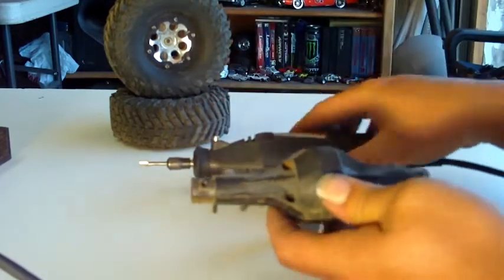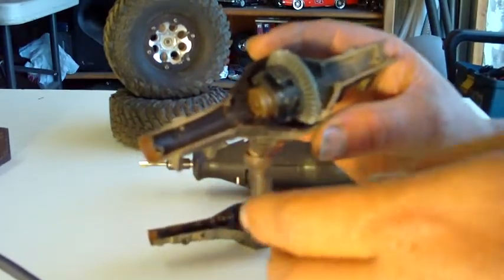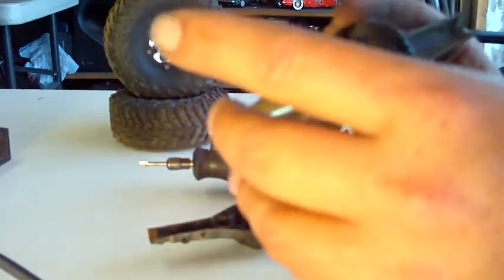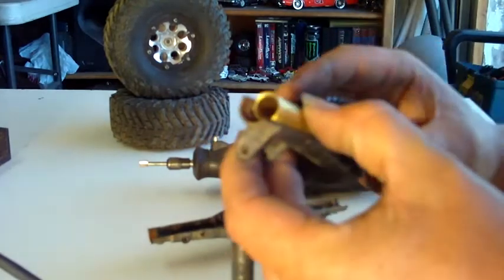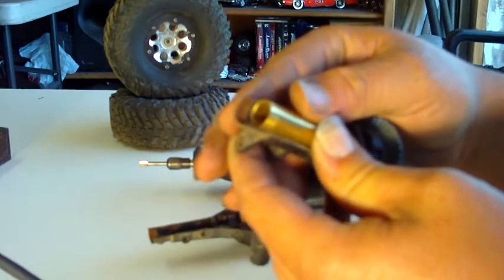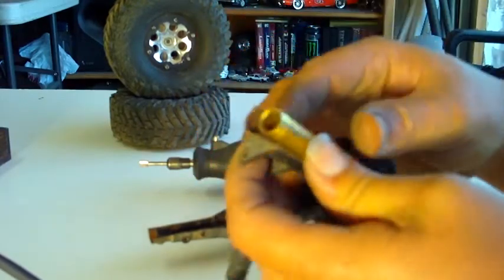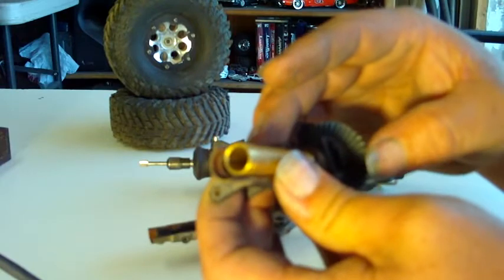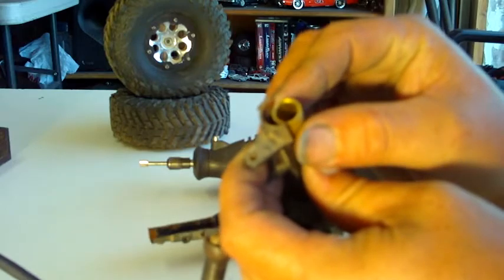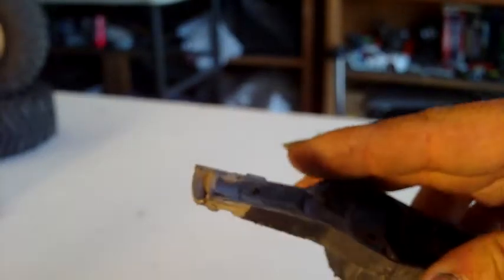We crack this axle open — it's not too terribly dirty. Right in this area there's a small mounting point that's not going to allow this tube to sit exactly where it needs to, so we're going to have to take a little bit out of that with the Dremel to make these sit flat inside the axle. Once we've done that, we'll line it all up and know where to drill the holes to mount up our new axle C's — or used axle C's, whatever you've got.